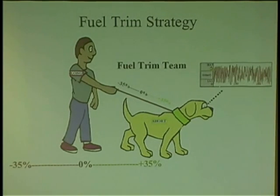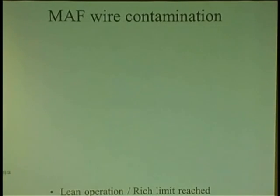See, computers have to look at the sensor, and their whole job is to control the O2, keep it switching. Because now this guy is the main feedback to keep closed loop operation working properly. It has to maintain the switching. It can't be high all the time. It can't be low all the time. So its goal is to keep it switching, but it depends where it ends up. You end up beyond 15% long term, you're going to put a check engine light on. There's just no two ways about it. So you've got to find out what the problem is going to be.